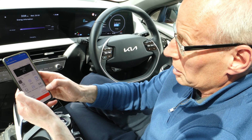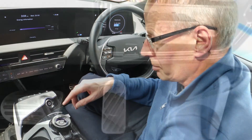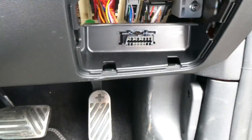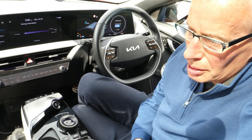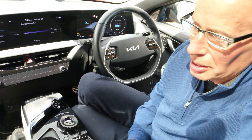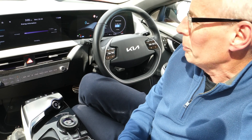When you've finished, just disconnect it, turn the car off, and turn the adapter off if it has a switch, then pull it out. Replace the cover — note the way the fuse label is written: the fuse has to be pointing upwards. Put that in top first. If you've just got a new adapter, be aware and read all the warnings at the front of Car Scanner — everything you do is at your own risk, and plugging things into the car is at your own risk. That's all it basically says.